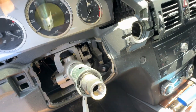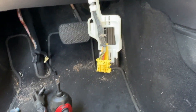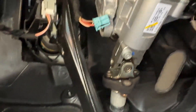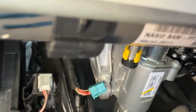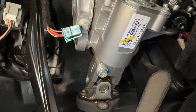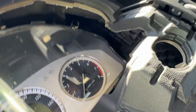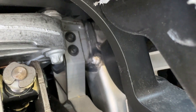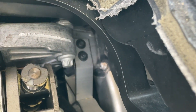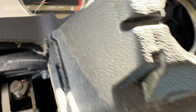Next I'm going to drop the column a bit to get the lock out. I'm going to take these two bolts out from down here — these are super easy. There's two bolts down here: one right next to the teal connector on that side, the other one's on the opposite side. Those are very easy to get out. I'm going to show you the hard one — there's only one hard one on this side here. Some people find it difficult to get this bolt out. It's the top right side bolt, and that's the one I'm going to show you.